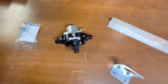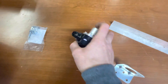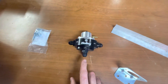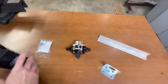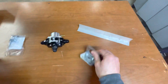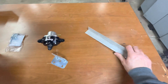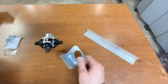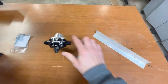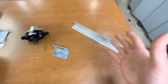So here's my fuel pressure regulator I picked up from Holley. I have 8AN fittings on the ends of it already — they don't come with it, had to pick those up separately. Amazon parts, pretty inexpensive. Here is your part number for the regulator itself. And then this is the bracket that comes with a little bit of hardware. And then I just have this piece of aluminum angle. If I can make this somehow a mount to the valley cover, and then this mounts to that, it'll all look good — especially after it's painted black. So that's the plan.